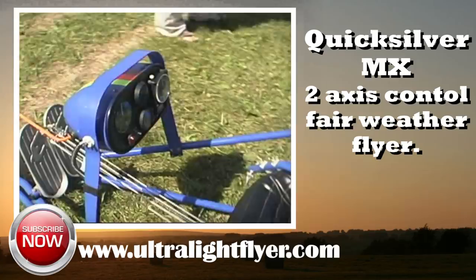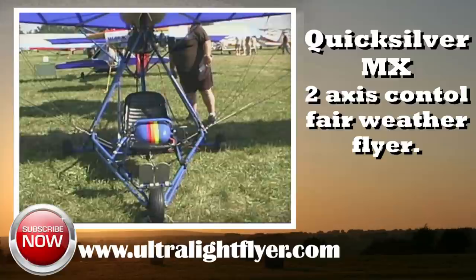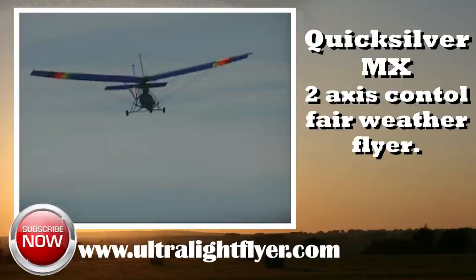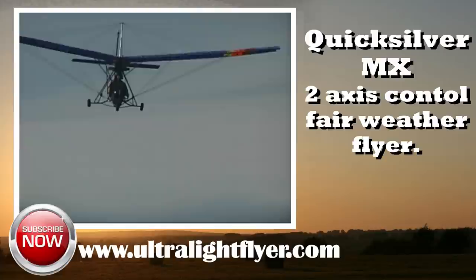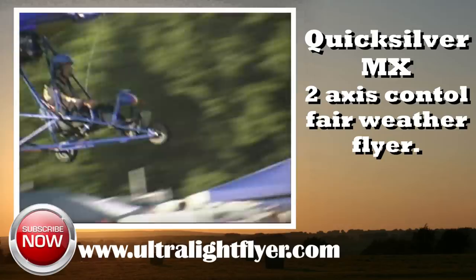If considering purchasing a used Quicksilver MX, it is the Ultralight Flyer's recommendation that the plane's fabric be tested and the wires, landing gear and reduction drive be thoroughly inspected. For a troubleshooting report on the MX, visit www.ultralightnews.com. If the history of the engine is unknown, it is recommended that the exhaust be removed and the pistons inspected for wear and seizure. At the time of production of this video, the Ultralight Flyer would estimate the value of a used, not abused Quicksilver MX is $3,500 to $5,000.